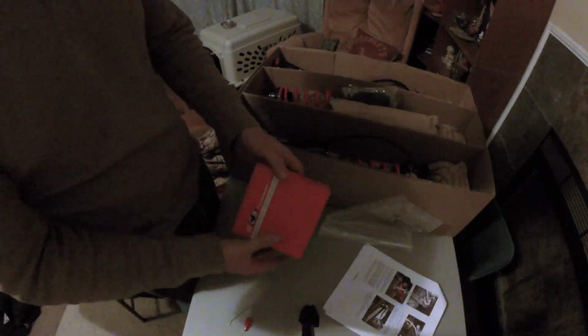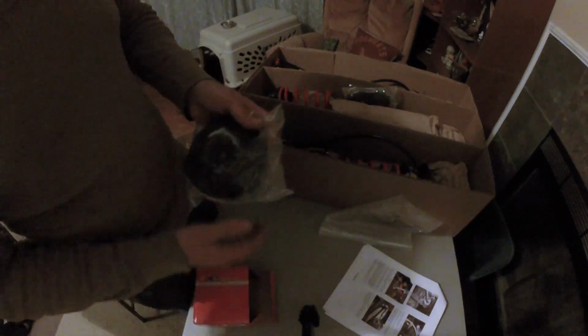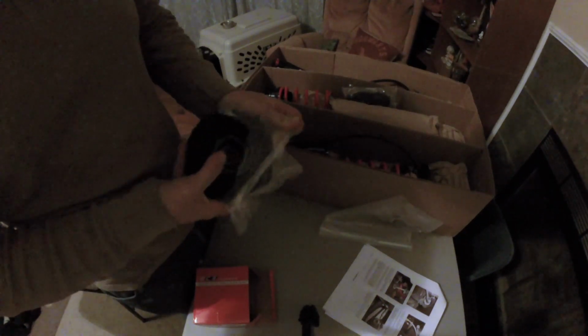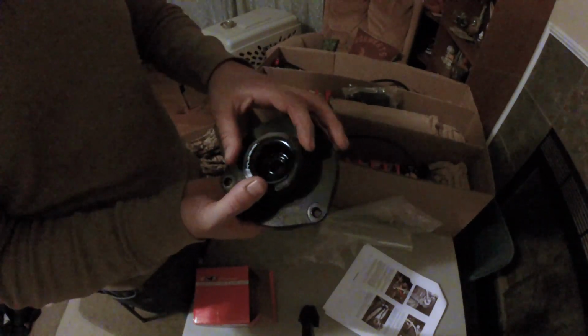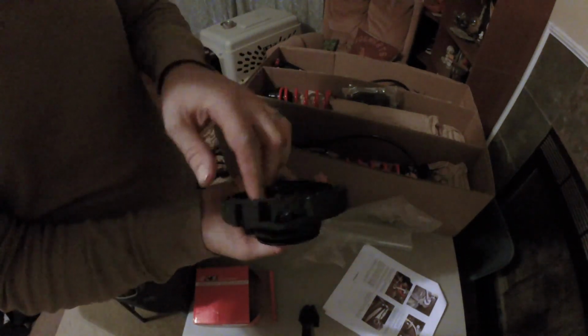But moving on. To go along with these, because they don't come with any proprietary strut mounts, I have some of the ECS Tuning heavy duty shock mounts. So these are a little bit thicker or a little bit stiffer of a rubber, but still a factory drop-in replacement part. There's speculation that these are actually just an Audi TT replacement part, because the TTs have a little bit stiffer mounts. But anyways, it's got the little branding on it, which is nice.